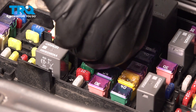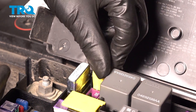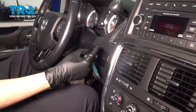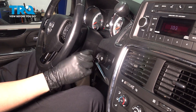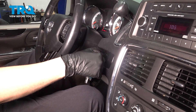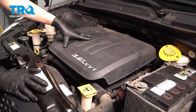Now let's put our fuel pump fuses back. The 10 amp fuse goes on the top — press it down all the way until it's flush with the others. The 20 amp fuse goes right over here. Press that down. If you used your fuse puller, put that back in and close the fuse box. Now let's prime the fuel system. Turn the ignition to the on position — I'm going to do this 3 to 4 times, or as many times as it takes to get fuel through the fuel rail. Shut it off, then turn it back on — the pump will run for a few seconds. After doing this a few times, start the engine. When you start it, keep in mind it may start and then die, so just prime it again and try again until you get proper fuel pressure. Now with everything back together, turn the engine on and take it for a road test.